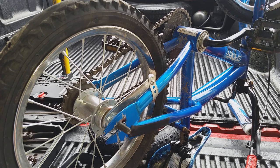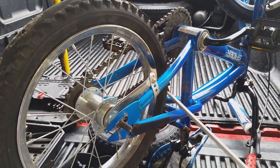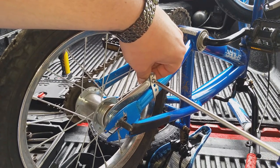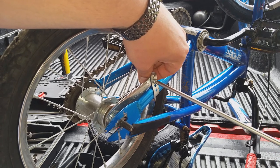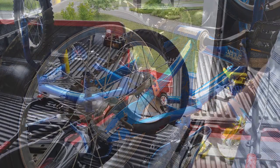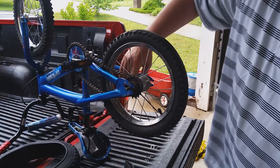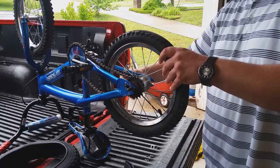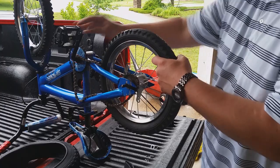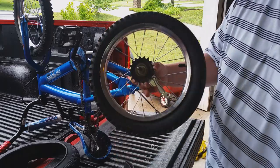After you take your outside nuts off, you'll notice this one has a little screw holding a bar in place which is keeping the wheel in. Go ahead and take this screw out — it also has a nut on the back side so you want to be careful not to lose it. Now that we have both outside nuts off and this little arm disconnected, push it up, take the chain off over your front sprocket, pull it out, and disconnect the chain from the back and your tire is off.